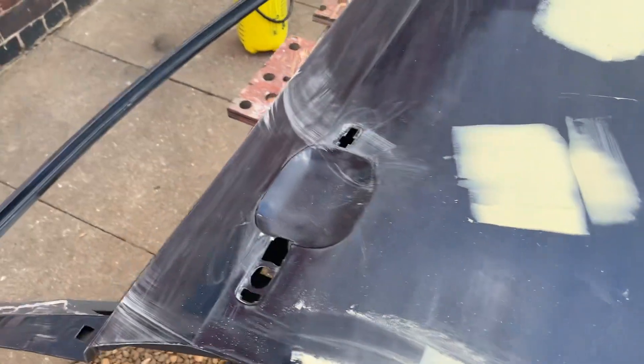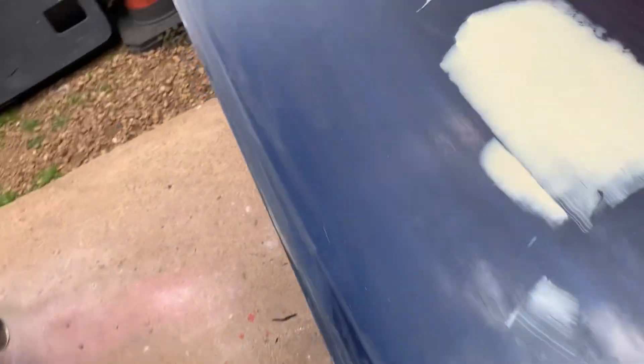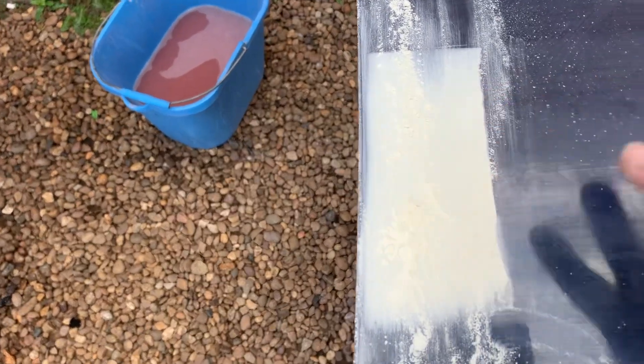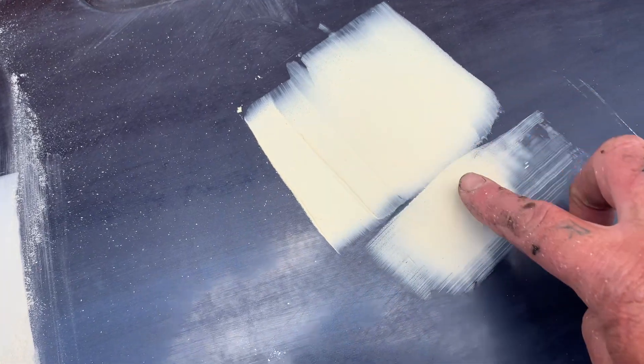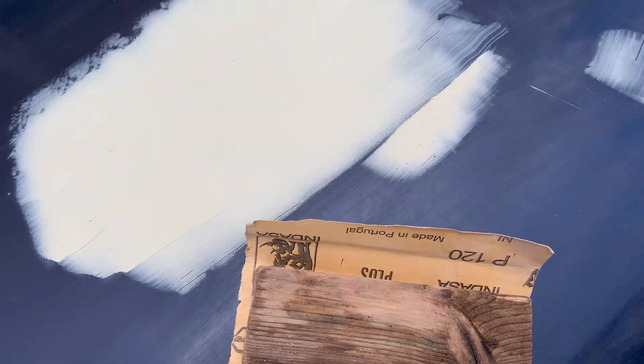What I'm doing now — I've got this other door, a black one, had it for a long while now. I've done all the other side, that's all in prior to now. The door looked absolutely mint, so I've flatted it. Same as the rear quarter, just using the lacquer as a guide coat, and come up with two dots here, two there, a little one there, four there, one there — and these are just scratches.